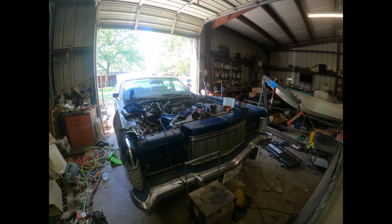What I think happened was, when I cranked it up, I was watching the oil pressure gauge, and that gauge goes up to like 300 psi, and it was heading towards 300 psi, and then that filter blew out. So I think the pressure regulator in the oil pump is stuck, and it's just blowing oil filters out because there's so much pressure. Very unfortunate.